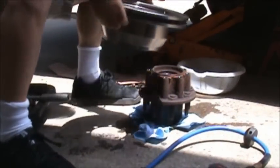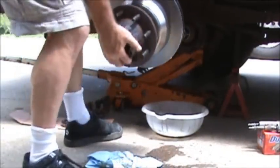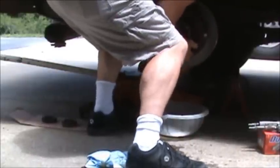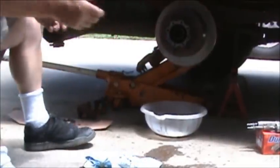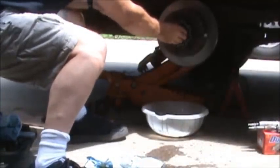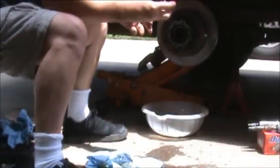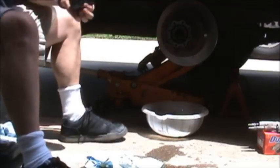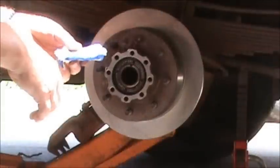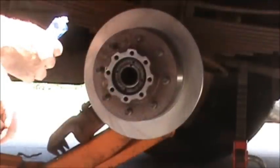New rotor — we're going to drop it right on here. We've got our rotor on our hub. Now we're going to stick our hub back on. Now we're going to put the bearings in it, then we're going to put our little special nut back on there and snug it down. Before I put the axle in, I'm going to put some silicone sealant on here to form a gasket so that it doesn't leak.